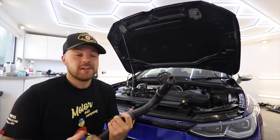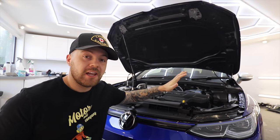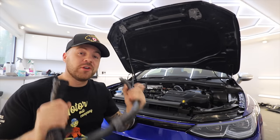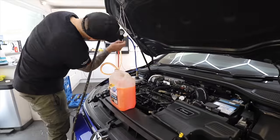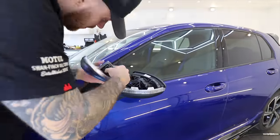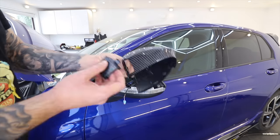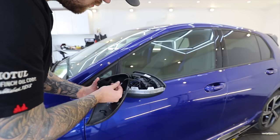The new pipe has just got here — you can see how it's supposed to look, definitely without a big gouge in it — so we can get that on the car. I've secured the radiator to the intercooler better now, so fingers crossed this one doesn't wear again and we should now permanently hold coolant. We can now refill the system using the vacuum filler, which is going to make sure that we don't have any airlocks. And now on to the final piece of the Auto ID kit — a nice simple one: new mirror caps. The silver really didn't tie in once we had all this other carbon stuff on there, so fitting these gorgeous carbon ones made the world of difference.